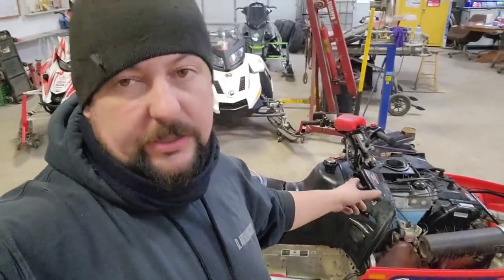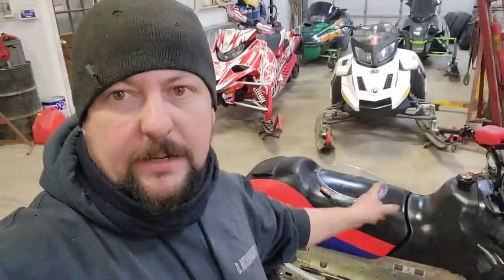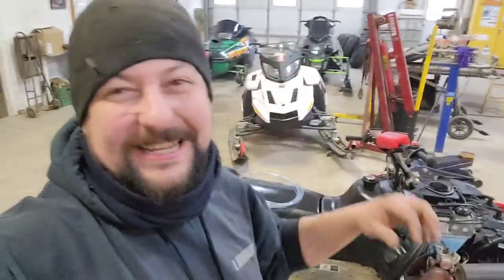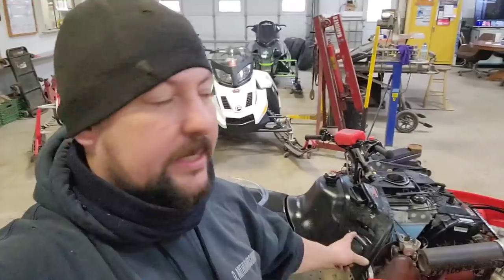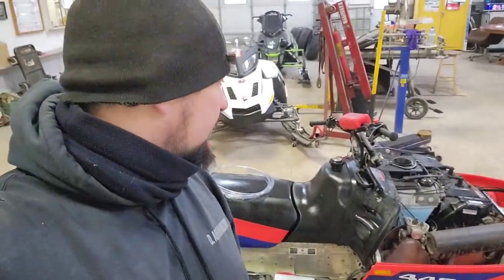So just going to pull it back apart, get the airbox out of there, pull the carbs off. We'll clean them. I'm going to drain, I got my siphon hose there. We'll drain the fuel out of that tank because we know it's junk. After going by the ZRT and finding the surprise in that fuel tank, it's a great idea. Obviously, if this thing hasn't been running for this guy for a while, there's probably all kinds of junk inside that tank. So we'll siphon her out into some old race fuel cans, that way we can dispose of it and not reuse it, and not get it mixed up with a regular jerry can of gas. And then we'll carry on.